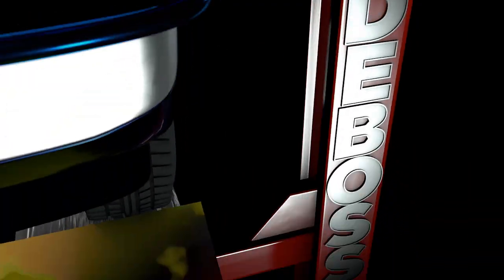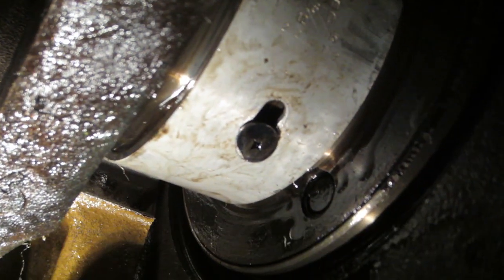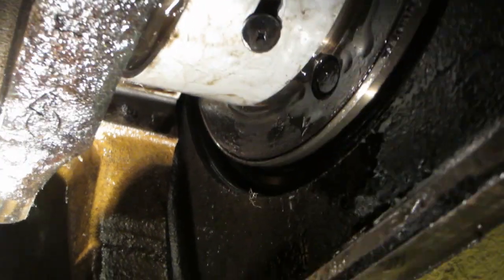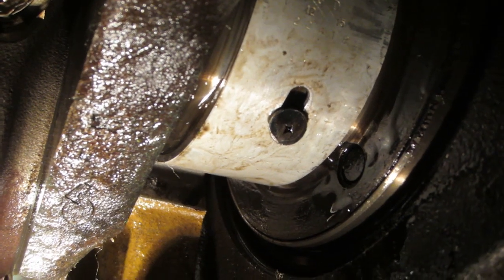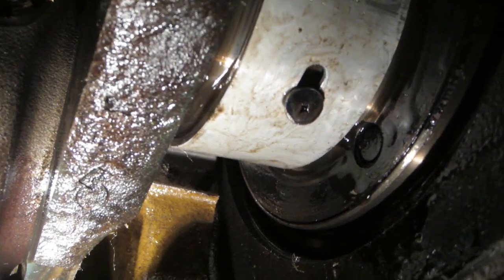It's also handy when it's hard to start — just put the set screw in through the oil hole and spin it, and it'll pull the bearing up nice. This back one just wants to be a little extra tight. Make sure it's centered and don't force anything. Putting that little set screw in the oil hole gets you that first little turn, then you can pull it out and try pushing it by hand or put the set screw behind it again.